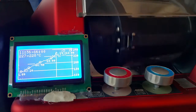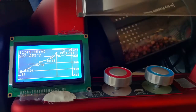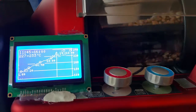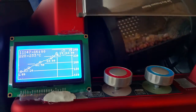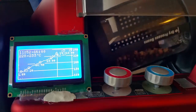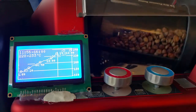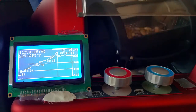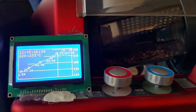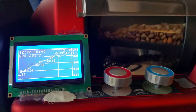We're now at 11 minutes and as you can see, a line appeared that tracks your current roasting time. It helps to see where you currently are, but originally it was meant to detect your first and second crack, which did not work as intended. The crack detection would look at the heating or exhaust temperature for a small bump that dips and rises again, but it did not work as it should.